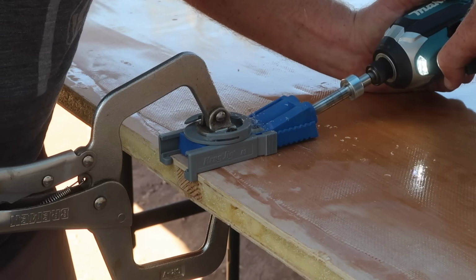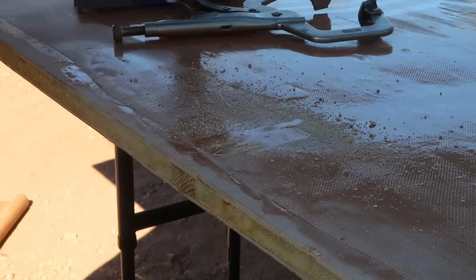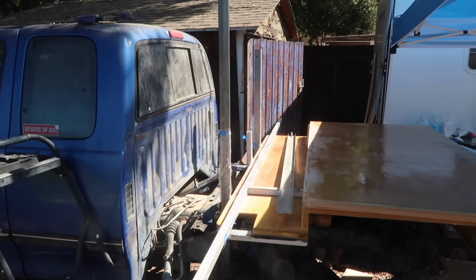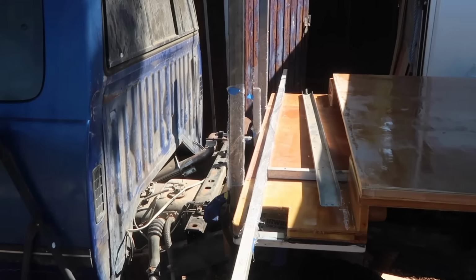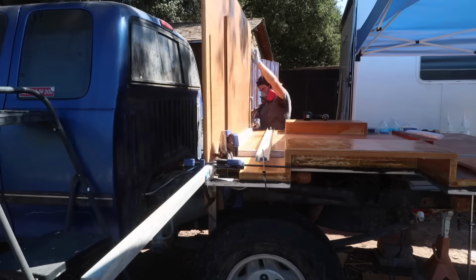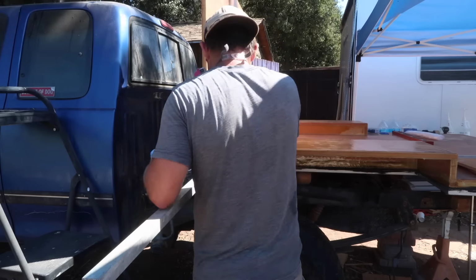Once the epoxy cured, I drilled out pockets in each of the 4 vertical frame members so that I could screw the wall to the floor once I got it in place. With the subframe floor assembly pulled out away from the truck cab for better access, and lots of scrap material staged to help me keep the wall vertical, I used an epoxy paste and 4 pocket screws to attach the wall to the floor.